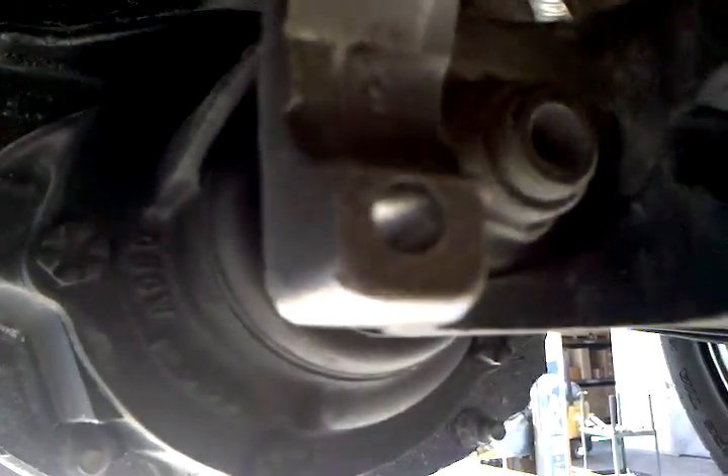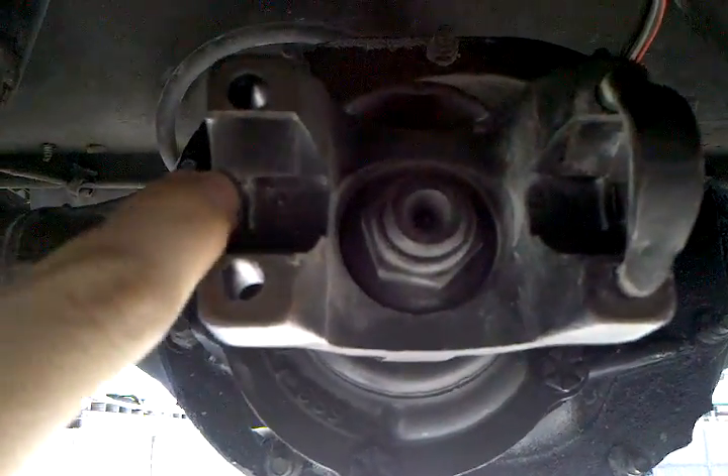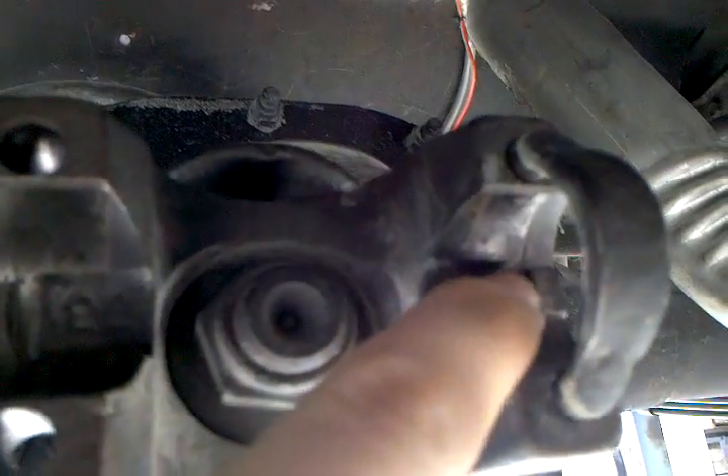Another way to tell is that it does have a drilled hole. If they are threaded, you are going to need straps. Another important measurement: you have this tab right here, which means it's an outside snap ring. So you're going to want to go inside of this groove to the inside of this groove.